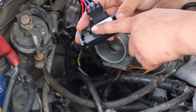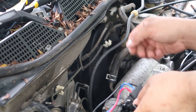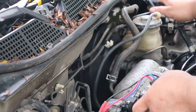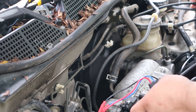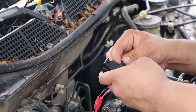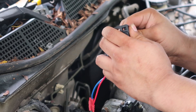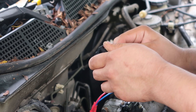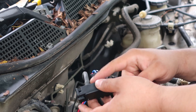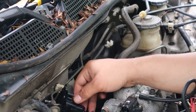Now that leaves us with just a vacuum port on the sensor. There's a vacuum hose that comes off the back of the manifold, goes into a little check valve, and there's a canister on the far backside that's actually been deleted — it's been plugged up since I got the car. So I'm going to unplug that and use this little hose to plug into the three bar MAP sensor. It seems to be just the right size for a nice tight fit — actually kind of swelled a bit, that's how tight it is. I'll go ahead and get some zip ties to secure the hose connection and zip tie the sensor somewhere behind the manifold.